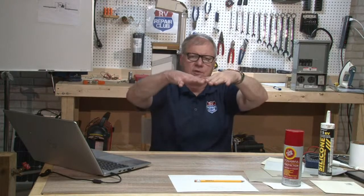So I think what you're looking at is the gravity fill on the side of your RV. You should have either a door or a recessed area where you can put a garden hose in and run the freshwater in, and that should fill your tank. And that should be very close, just straight down. Most of your tanks have the inlet to the side, three quarters of the way up, or even a little higher on the side of the freshwater tank itself. Some of them do the top, but usually that freshwater tank is right up close to where the floor line is, with a little vent tube on it. In 1988, the challenge you're going to have is there's probably no documentation left for that.